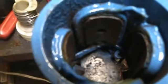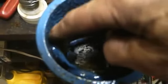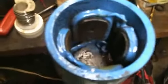How we achieve this is a little old wire brush into my old drill here, and we just run up and down like that. As you can see, now we can obtain a magnetic field that'll spin that old armature. In case you wonder how a starter works, basically your field winding has been in pretty well the same setup as your armature. You have two north poles, so we're going to call these the north poles, and we're going to call these two the south poles. And that's what works the magnetic fields, so that it spins that armature.